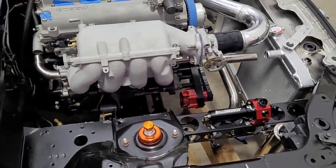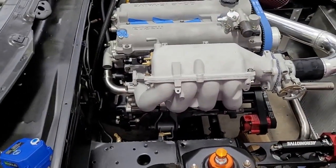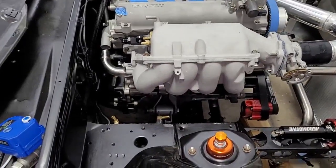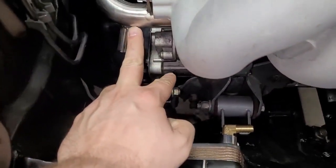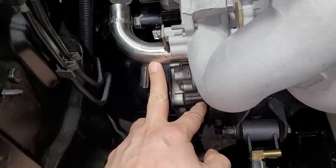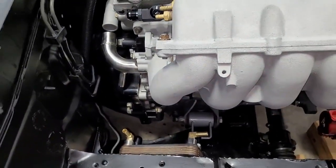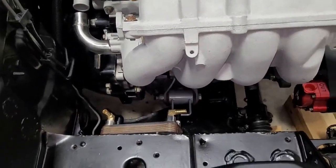So we do have to work that detail out, and then on the cooling system, we were also planning to do pressure on that as well. So I have to look. I just thought of this. I guess I could weld a boss, but these are attached to the motor. These are going to vibrate, and if you hook a sensor to that, the sensor is going to vibrate. But I want to measure coolant pressure somewhere, so I've got to think about where to put that.